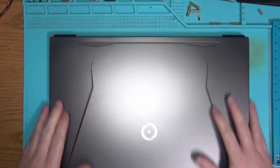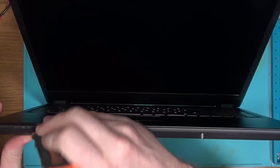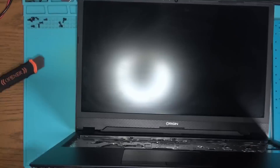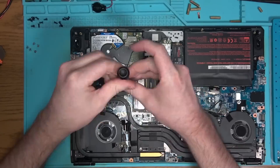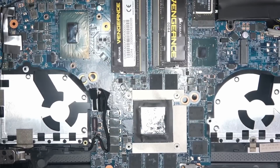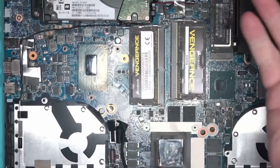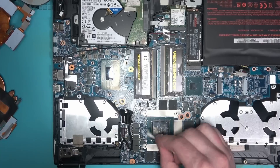Let's remove the backplate and see what's under the hood. Since the owner mentioned liquid metal, it made sense to lift the heatsink and look around — and guess what I found? While the GPU is soaked with liquid metal, the CPU is completely dry. I'll get rid of this liquid metal, apply some paste, and see if that helps.